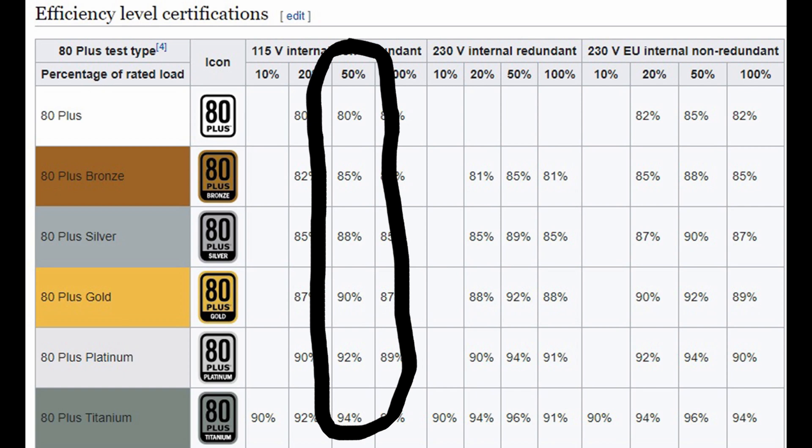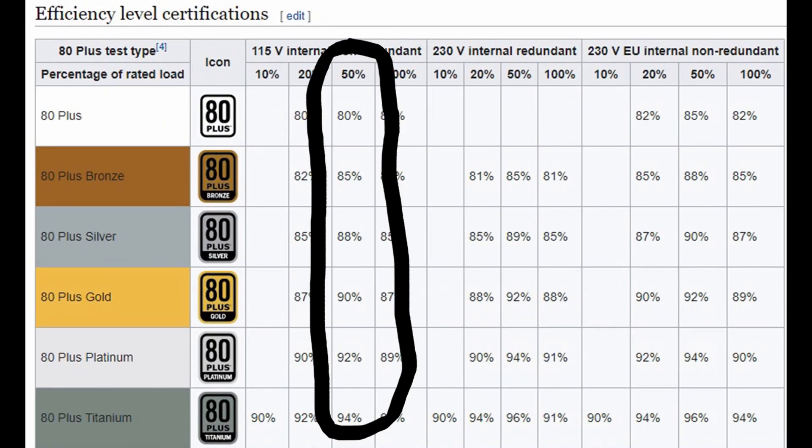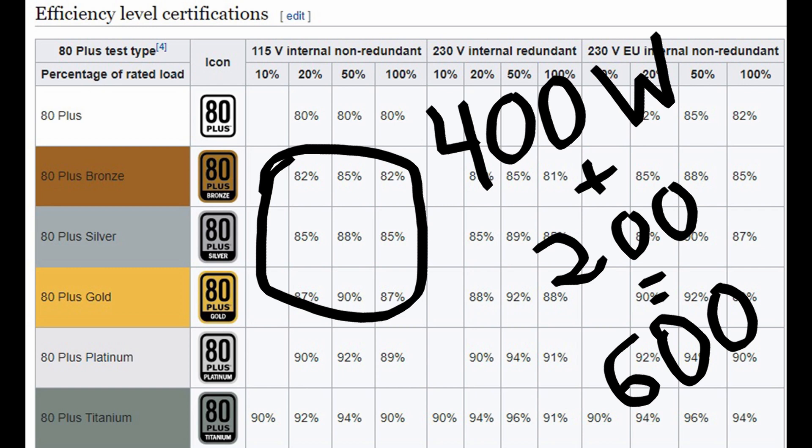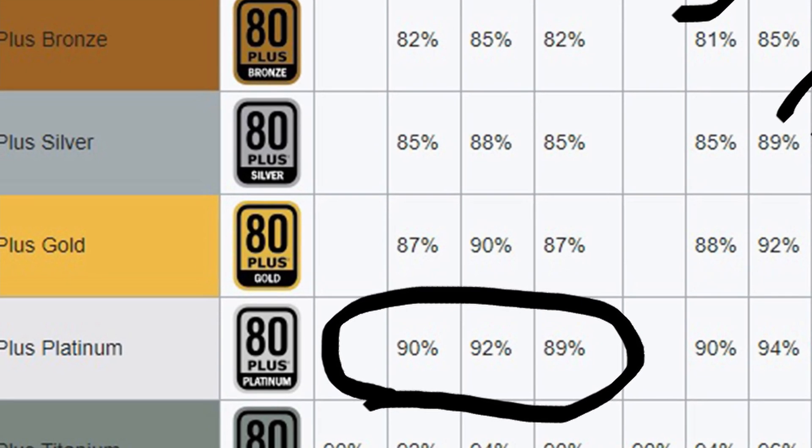My system at full speed will use about 400W or so. To give some cushion, we add about 50% more to the PSU requirement, so I'd need a 600W power supply at the minimum. But my graphics card recommends at least a 650W power supply be used, so I went ahead and got the 750W PSU.